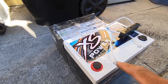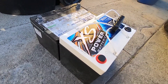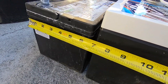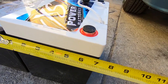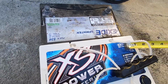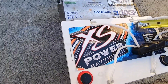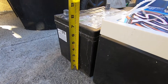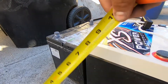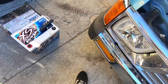So this is a side-by-side D2400 next to the battery that came out of the truck. I don't even think that battery was for this truck, to be honest. The width measurement from the side of this battery is roughly six and a half inches — the D2400 is also six and a half. The length is ten and one-eighth. This is where the issue is: the old battery is seven inches tall roughly, and the D2400 is about eight and one-eighth — so it's actually about an inch taller. But let's give it a try.